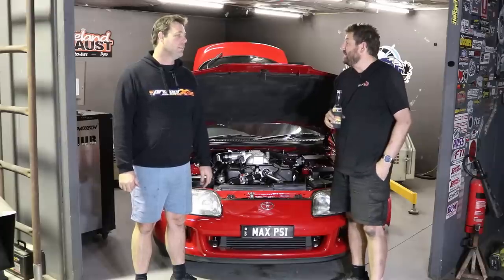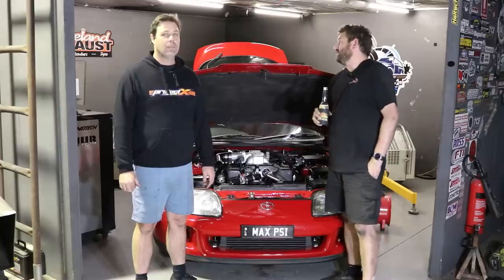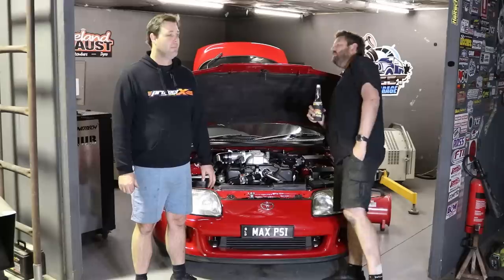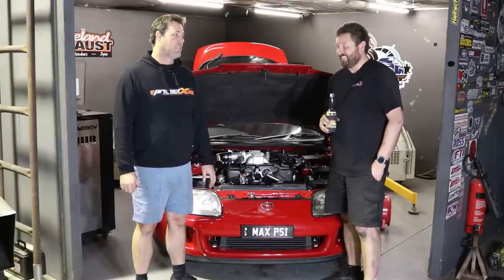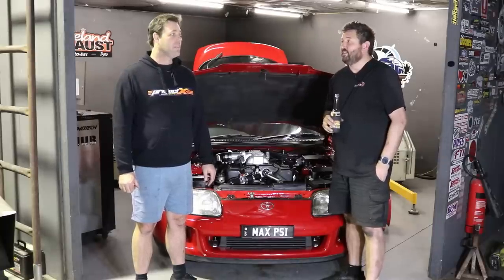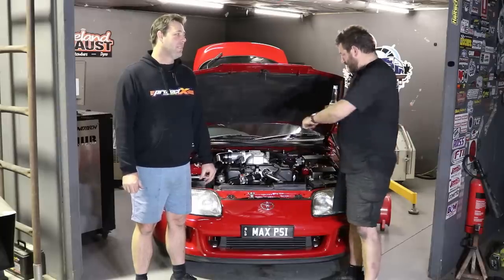And then I actually did a gear change on the dyno. I short-shifted it at 6,400, and it had 732 horsepower by 140 k's an hour. So it's going to work. That's pushing some steam. And I short-shifted it, and that was the nitrous turning off at 5,500. It's going to be quick. I'm actually a little bit worried.